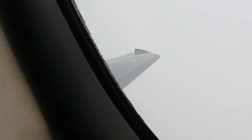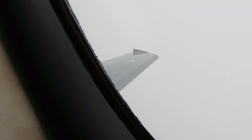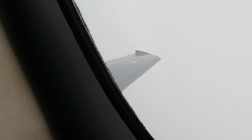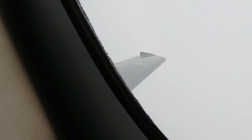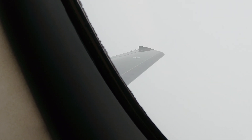As you can see now, it's inflating the upper zone. It'll do that for about six seconds. As you can see there — I don't know if you can see or not — but there's some trace ice on the leading edge of the wings right now. It's actually on the line between the two zones, the bottom zone and the top zone of the pneumatic boots. So there's not much we can do about removing that while we're up here. That's a non-protected area, so to speak.